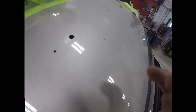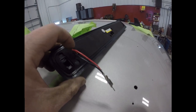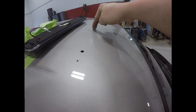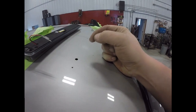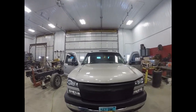For measuring where the wiring harness comes through, it's exactly one inch off of this hole and dead center in line with these screws. Just take your tape measure, run it across, one inch, center punch, and you can drill your hole. We got the cab lights installed — all we have left is to figure out the wiring.